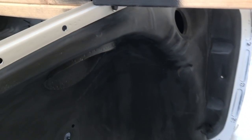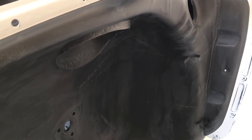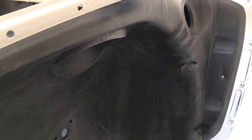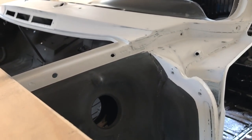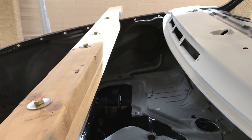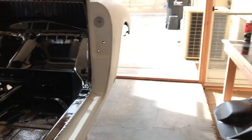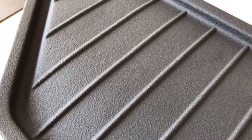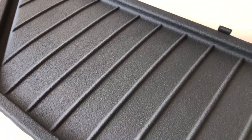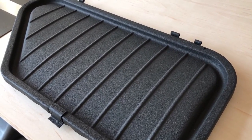So what I'm going to do is go with the Transtar and then top coat it with a matte finish urethane 2K top coat — basically a matte finish clear coat like they would put on the outside of a car, just like high gloss only matte. That's going to go underneath in the fenders, inside the trunk, and also the engine compartment. I shot this sample — it had some fairly aggressive pitting, and the Transtar just cleaned it right up. I'll probably put one more coat on there, then top coat it with my matte finish. That's going to be a beautiful look for this car.